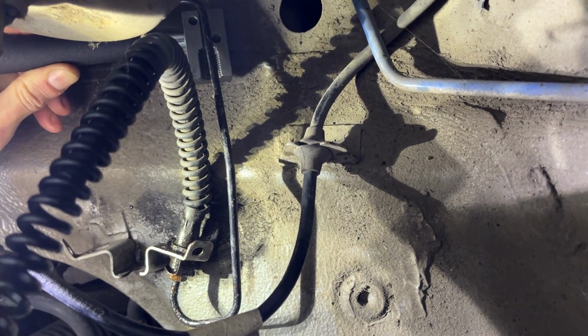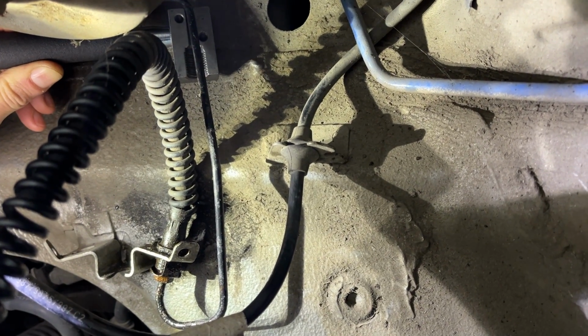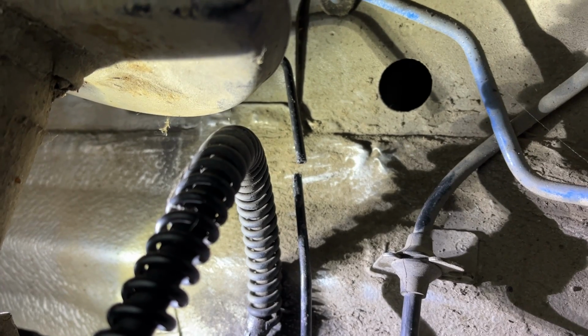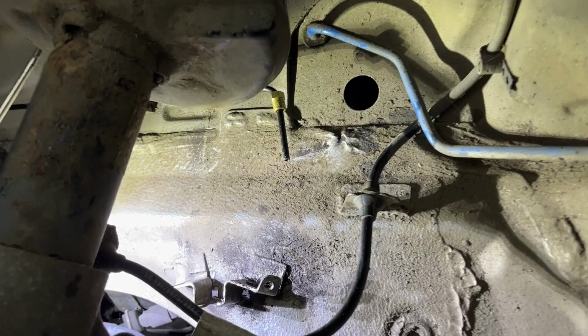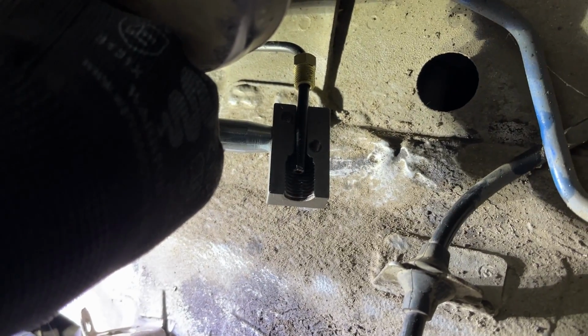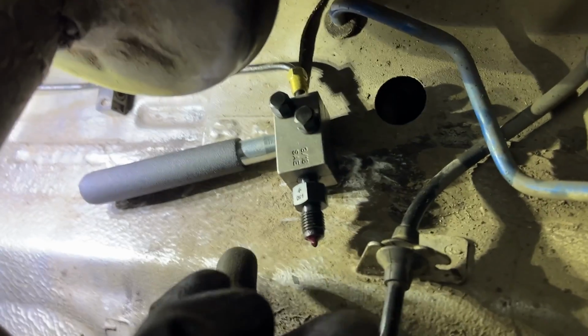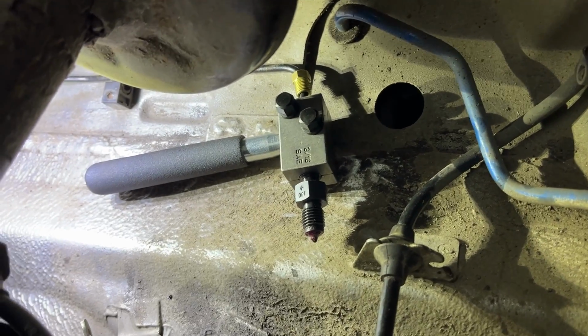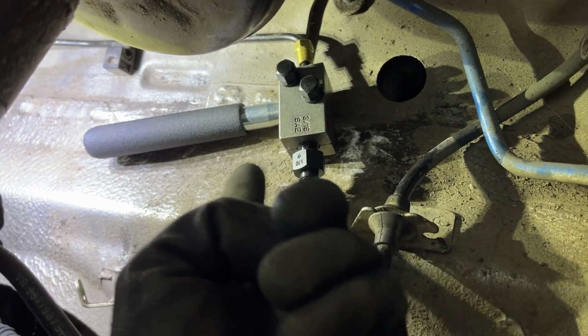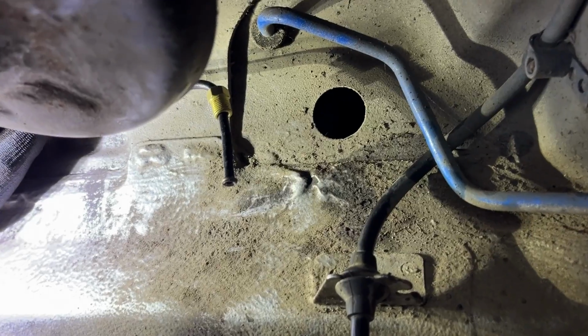I'm completely out of my comfort zone doing this. I've never done this before. So here goes. Well, that's cut. No going back now. Right, with that stuff out of the way, I've put my little nut up there and use the flaring tool here to make the flare. I've used a special end piece to get the pipe lined up correctly, locked it down using the 2 tightening nuts, and then I'm going to do the first punch by screwing this in. And there we go, we have a flare.